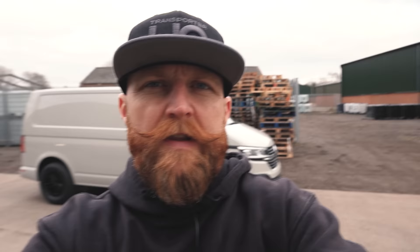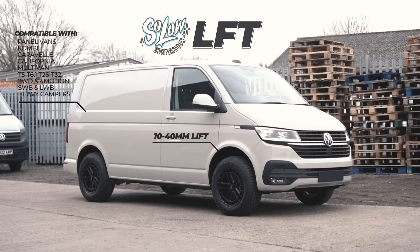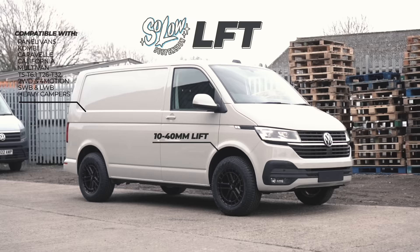When we first fitted the prototype — maybe the second or third revision — I was driving it and was surprised how comfortable it was. Historically, whenever I've been in lifted vehicles I find the ride really firm because they have to make the spring harder to get the lift. That's exactly where we didn't want it to be. We wanted the comfort of a lowered coilover but with lift to get you the look you wanted. Having that full adjustability front and rear is where I think it's always been missing. There's no reason why you shouldn't be able to lift and have full adjustability the same as you do when you're lowering — not just relying on the weight in the back and balancing the front out.